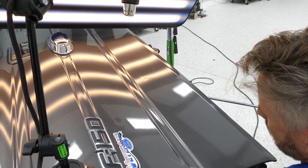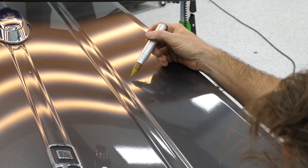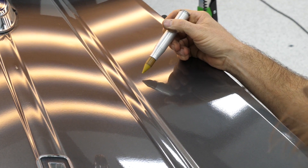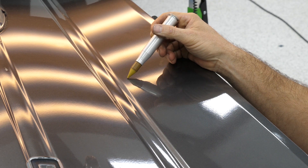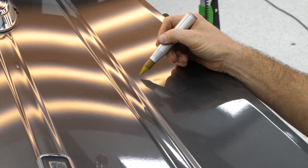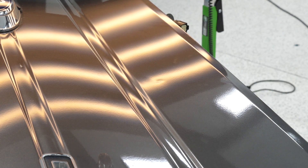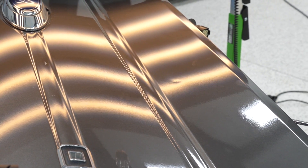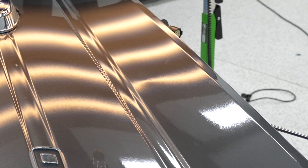I don't know if the camera will pick this up, but you can actually start to see now — these two dents were connected and they're in an actual low form. Right now we have a few tiny push marks that will sand out; it still has a little bit of a low running this way. I'll wait and come back to this one as I get this one a little more tight. With that light I can see it clear as day.